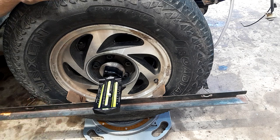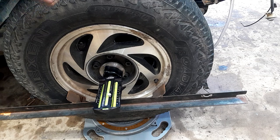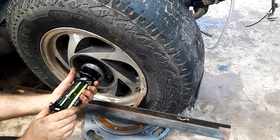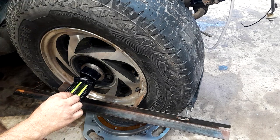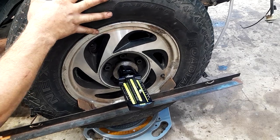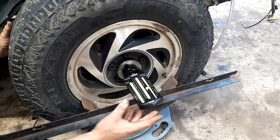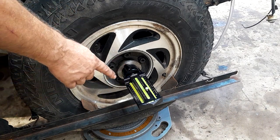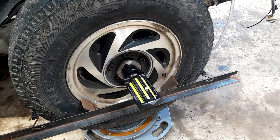It has to turn and bite - kind of like the rudder on an aircraft or a ship. So the way this works is you turn the tire out on your turntables 20 degrees, level the gauge out, and zero your caster gauge. Then you turn it in 20 degrees, level it back out, and read what's there. According to this, we've got about four and a half to five degrees of caster. The factory spec on that is three degrees, so that's okay.